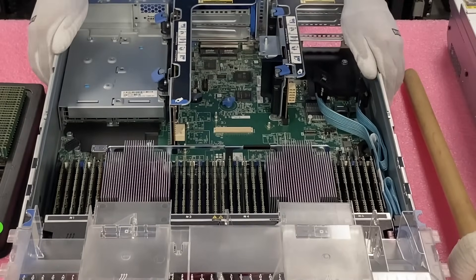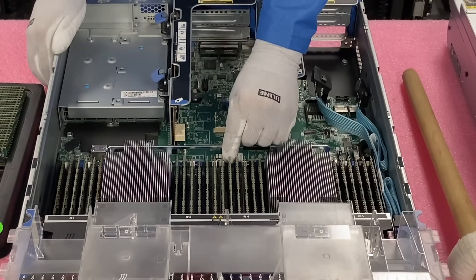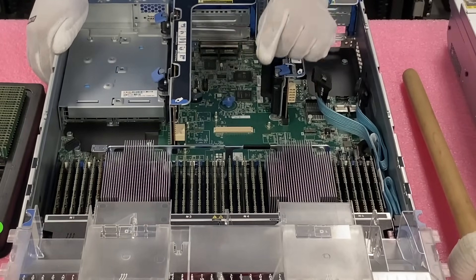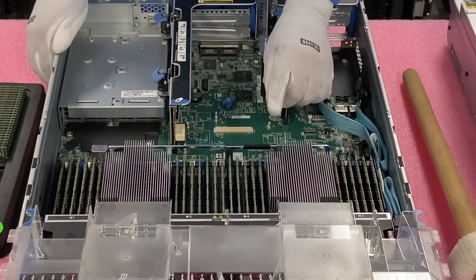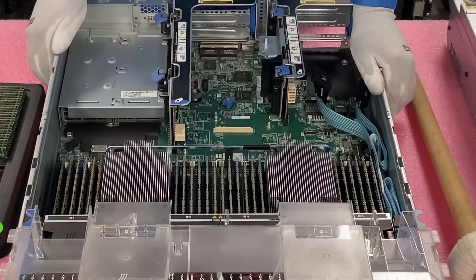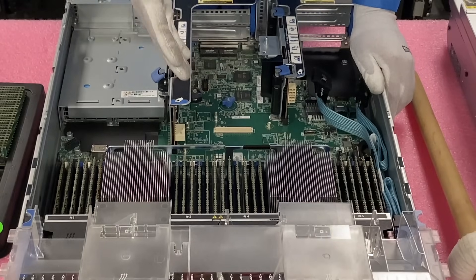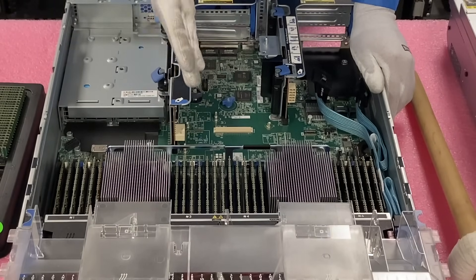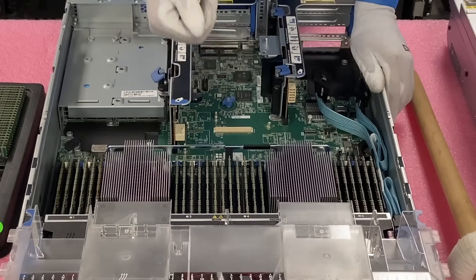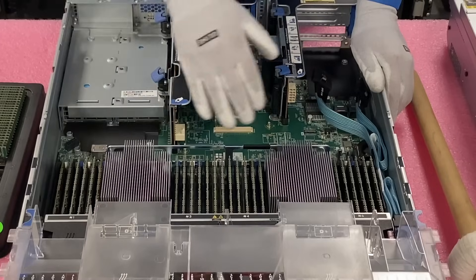I've officially loaded them all up. One thing I always recommend at the end: check all your tabs and make sure nothing is sticking out. Sometimes a tab will just be jutting out just slightly — that little bit is enough that you might even see it raises the module up so the leads don't connect. It's hard to tell — it almost looks like it's in. That's why I always talk about hearing those two clicks. Some people will say 'I have a bad DIMM' when really they just haven't fully inserted their modules. Rotate your modules around and nine times out of ten it fixes the problem.